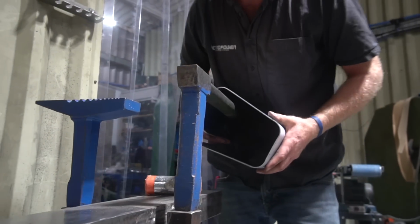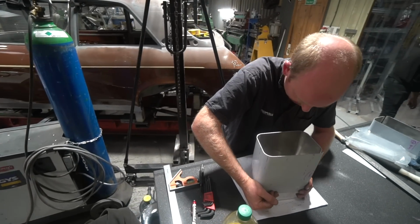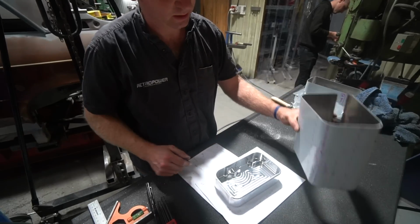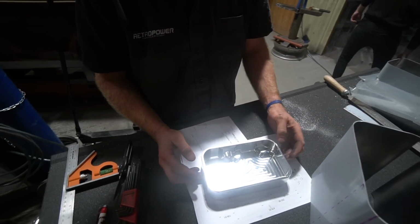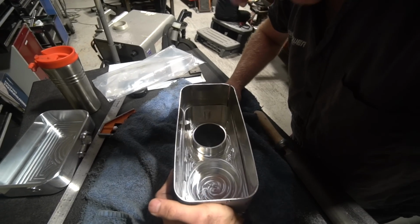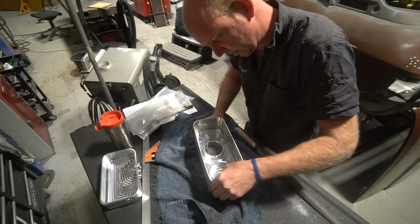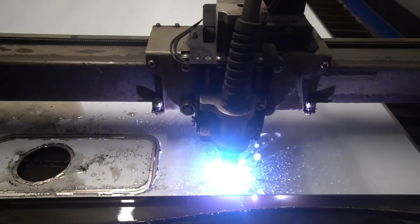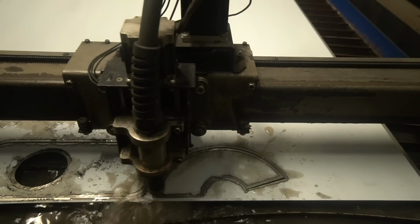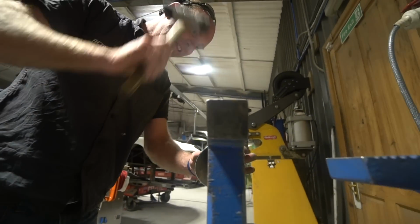It's just easier, nicer and much cleaner looking to make those pieces from machined aluminium, and then do the big bit that holds all the oil in between the detail parts in fabricated aluminium. It's just using the right processes for the right parts of the job. And yes, it's a fairly expensive tank at the end of it, but I don't think you could make it purely fabricated as neatly and still have it fit as neatly into the part of the car it needs to fit into. You can't just use a round tank because it won't really fit, and if you just fabricate a rectangular box, it won't have the right functions in terms of what it actually needs to do. So doing it from billet makes a lot of sense.